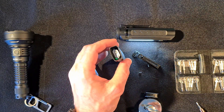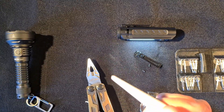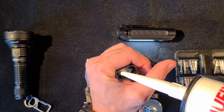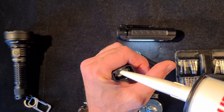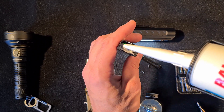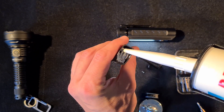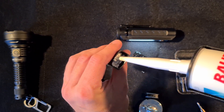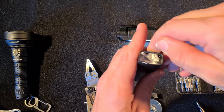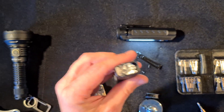So let's get some silicone. To fix the rattle, I just use some cheap acrylic silicone — I had that one open. I know there's better stuff as well. I used the white color so it's going to be easier to just remove the white silicone when I one day exchange the battery. Just give it a nice little bit of silicone around here. Then let's clean the area a little bit where it will seal with the silicone o-ring.